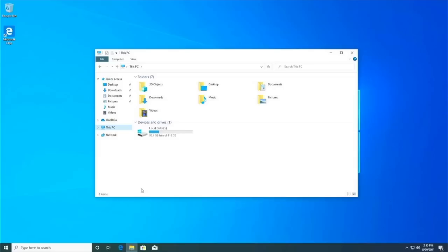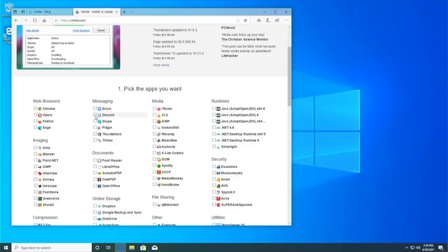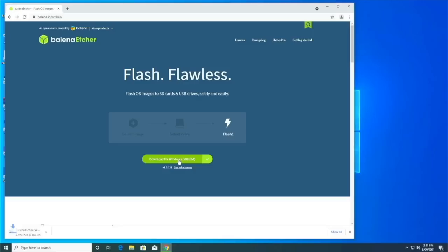When you first boot it up, it takes you through the entire Windows 10 walkthrough — a few minutes to set everything up. Once on the Windows 10 desktop, I first go into "This PC" to check properties and verify components. Sure enough, it has the J3455 CPU and six gigs of RAM, running 64-bit Windows 10 Home. Then let's install a few apps using ninite.com, which lets you choose standard apps like Google Chrome, Discord, or Steam and install them all at once. Another essential piece of software is Balena Etcher, which we'll use to flash the Batocera image onto the other hard drive.